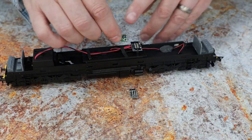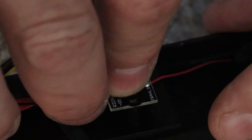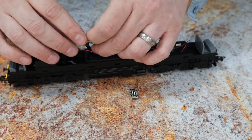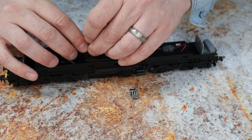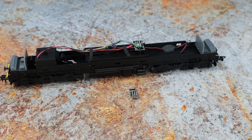That's it — top left. Push it in and make sure the pins line up, as they do bend really easily. I've not used as much force as it looks in this shot, but just make sure it goes home — it's quite a positive fit. Tuck the chip somewhere nice and safe out of the way. If there are lots of metallic objects inside like the chassis, you might want to put some tape around it to keep it isolated.